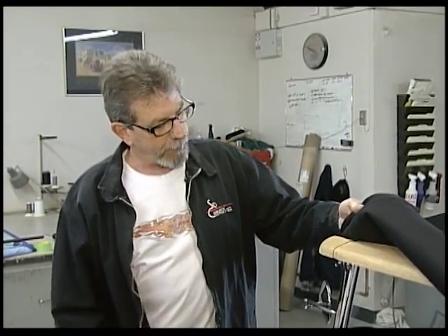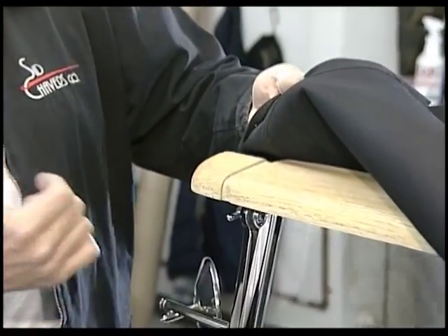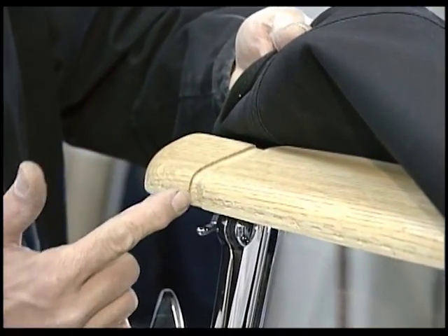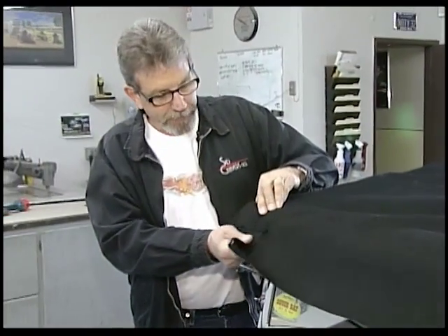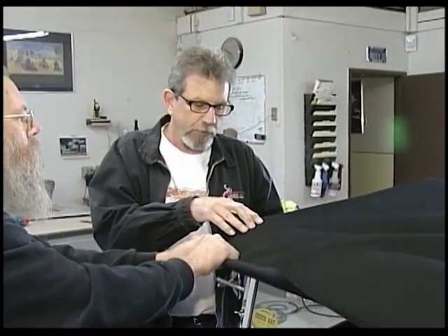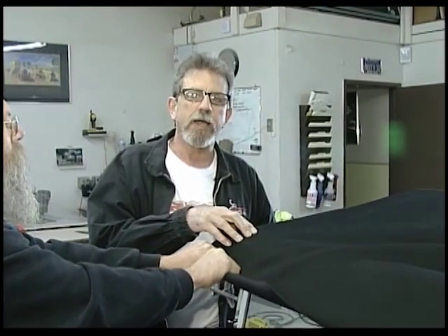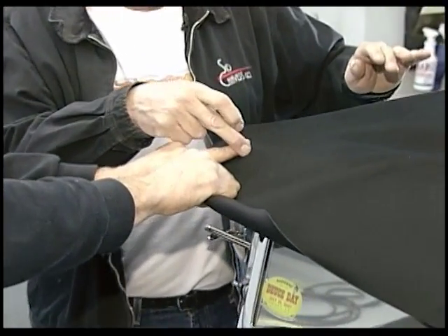At this point the installation is the same for either the rear curtain top or the smooth rear curtain top. There's a cutout in the header bow for the seam — line that up, and this is where your helper comes in handy. He's going to pull the top tight while you go back and check to make sure you get that seam right dead on center. Have him pull it a little tighter if needed. You want this top really tight — it's going to loosen up a little in time, but you want to start out a little extra tight. So he pulls while I check the back, and we'll put two staples in this seam.